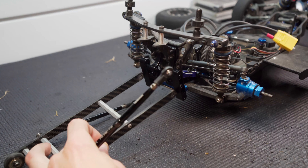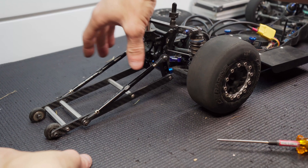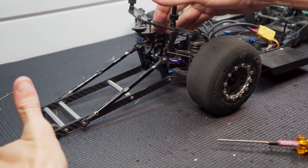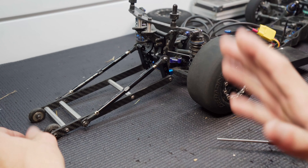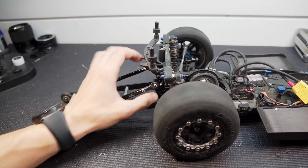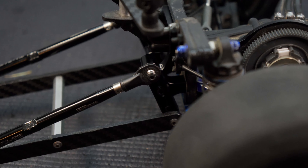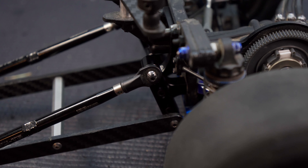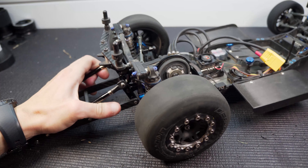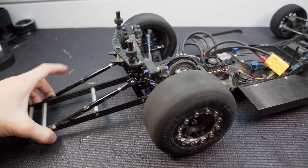I took the wheels and tires off to make it easier to adjust things. Since my wheelie bar is adjustable, I took the side plates and ran them all the way to the bottom. I just need to bolt up the wheelie bar — the side pieces are threaded and I can use the same screws as before with a tad of loctite. With the wheelie bar mounted, I realized I didn't have much height adjustment left and it was already touching the ground, so I loosened the screws and slid it up. I actually ended up flipping the plates around — longer section up top, shorter section on the bottom — to get more adjustment range. Got the tires back on and now I'm happy with where it sits.